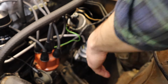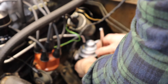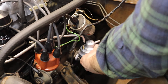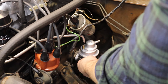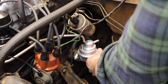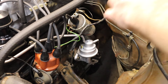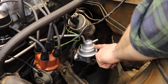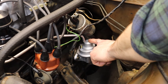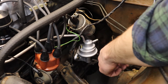You'll notice the plunger - you have to put a bit of pressure against the plunger as you put it in. That's what dictates where the cam is. I've painted this fuel pump up just a little bit - a quick scotch brite back and I've just rattle-canned a bit of paint onto it. It's not to make it look brand new, just to tidy it up. Everything had that much grease and oil on it. I took this top hat off, cleaned the filter out which had loads of rust debris in it - must be from the old tank. Cleaned the seal up on the inside and then replaced the O-ring at the top which was cracked and dried up.